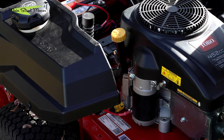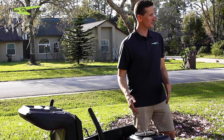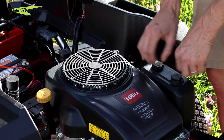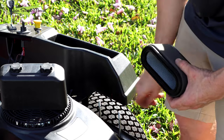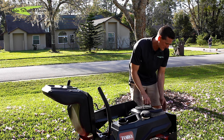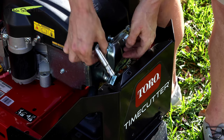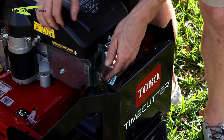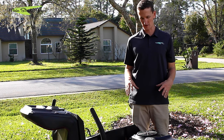Some of the other models have a hose that routes the drain valve out away from the engine. You also have an oil filter located on the other side — during an oil change that filter needs to come off and be replaced with a new one. You also have an air filter with two little tommy knobs holding it down; you just get one of these from your local dealer, slide it right on, and put your air box back on. Your spark plug is underneath this cap here and requires a long socket — three-quarter inch — to get in there and remove that plug.